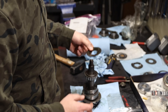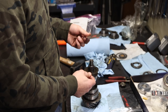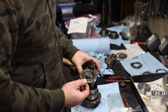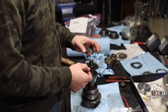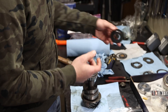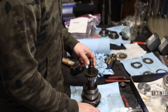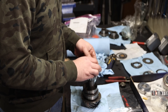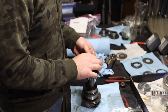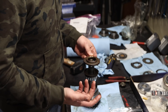So that's how you set your preload - clear as mud. Then on top of that sits an oil slinger. This is the factory oil slinger; this is the replacement that came in the kit. I'm not sure it matters which I use - I may just go with the factory because it's in pretty good shape, shows no sign of wear, and it's made it this long. Then on top of that your seal, then your deflector, then your yoke washer and nut. That is your complete stack.